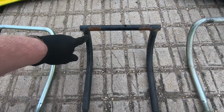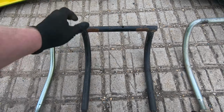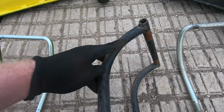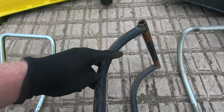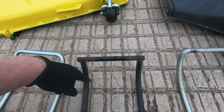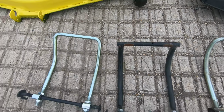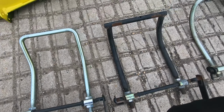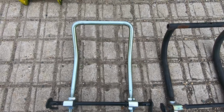But what I've noticed over the years, and I don't have an example, is that on a later series of these draft arms, let me hold this up right here, they put a support right here. I think I have a picture on my phone that I'll try to throw in there. So I think that these were bending and causing a number of issues with the decks. And then we have the newest draft arms, which are thinner in diameter compared to the older X series style, but they are just a solid piece of metal rod. They are not welded tube, which I think is interesting.